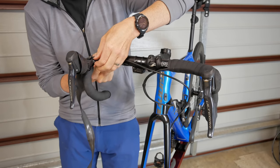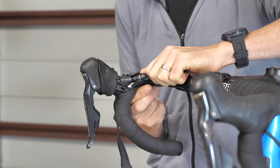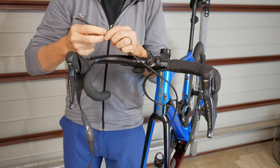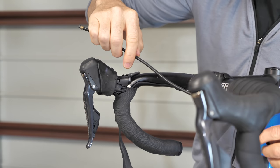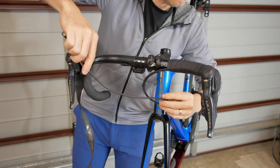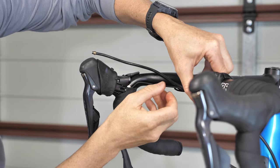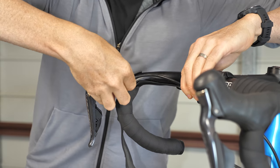The last few turns come out by hand and we are done. We'll let the nut slide down to the other end of the brake line — we'll be reusing that later on. But for now I have to determine the best routing for this brake line. There's no golden rule for this given it's a hydraulic brake line, so I'll try to go the most direct path — straight up and under the climbing shifter and then around that corner. Probably around two inches I'll take off this brake line.